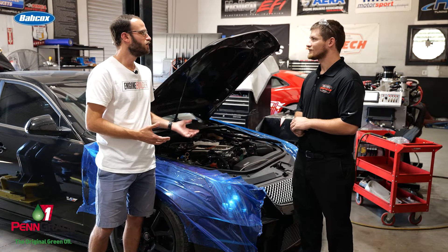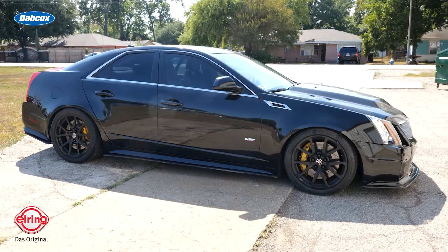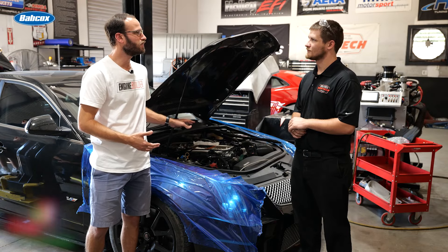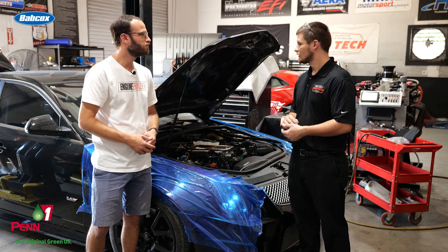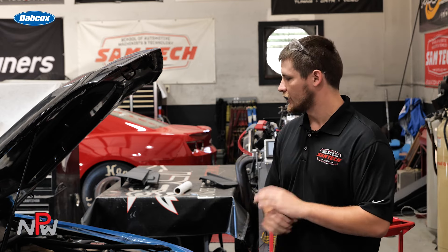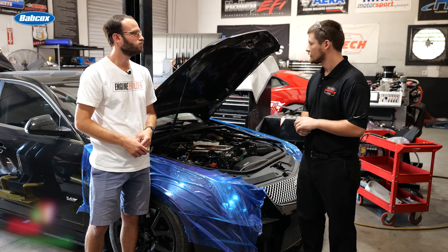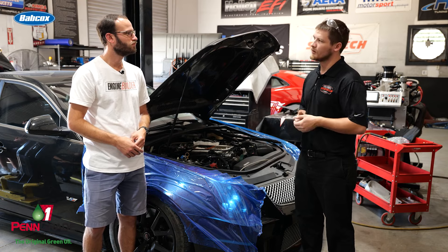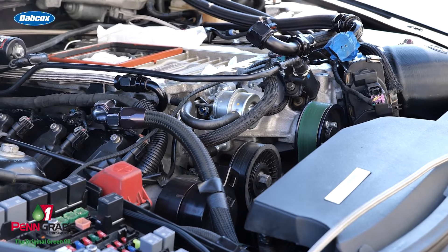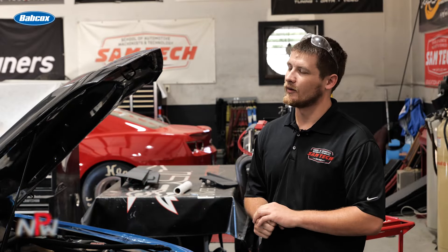He's doing some mile racing very shortly, trying to hit some top speeds in the mile. So you guys are also getting into some tuning work on it. Once we got the engine all together, we ran it on the engine dyno and put it in the chassis, then started driving it on our chassis dyno here. It turns out we wanted a little bit more out of it. For the mile, since we're going to be holding it wide open for a long duration, we actually wanted to put some extra cooling measures in there. We ended up getting a Pro Meth kit for putting the injectors up in the hat of the blower to cool it off, so we can try to keep everything manageable along with having a little bit more power and a bigger tuning window.